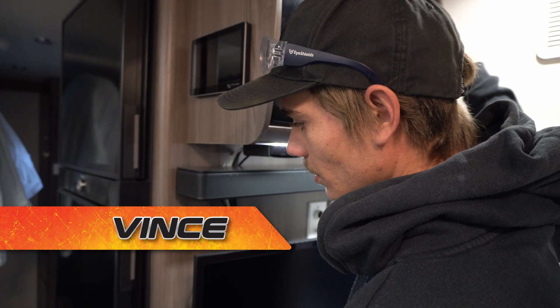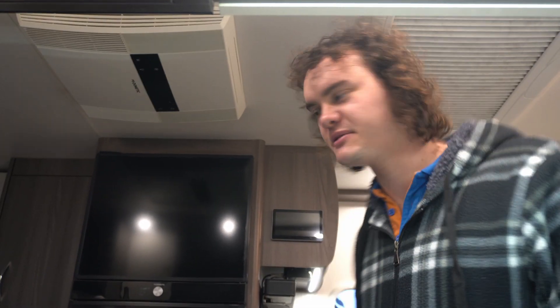What he did was, he saw the slide out was crab walking. That slide out's really walking. He used to work at Jayco, so he recalibrated that one and she works like a charm. The customer was also having an issue with their levelling system — it bluetooths to their phone so they can see if the van's level. There were about 20 odd Bluetooth devices under there, so the original sensor didn't like it. We relocated it outside of the battery compartment, on top of the bed area, and now the customer says he can connect to it just fine. That's been sorted as well — nice and easy.